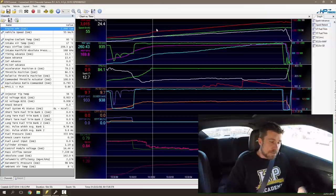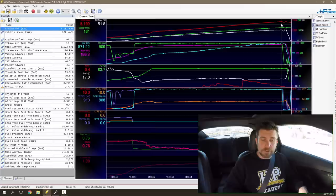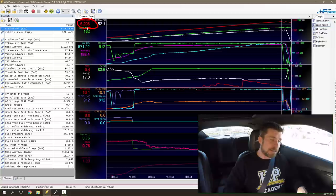Now that we're back in the pits, let's have a look at the results from that data log. In this particular log you can see that we've gone to full throttle - shown by the green trace - at around 3000 RPM, and I've used third gear for my tuning. At the end of the log file, you can see we reached 6200 RPM, which equated to 162 kilometres an hour.